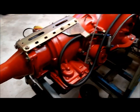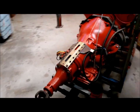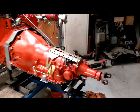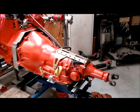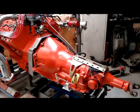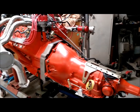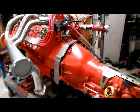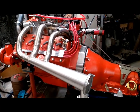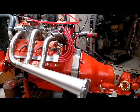I'm hoping our next video will show the whole unit installed into the chassis. One thing to consider when working with these engines — and a lot of other engines of course, but this one in particular — I've estimated that the weight of the engine, the adapter, and the oil in the transmission and engine is somewhere around about 1,350 pounds to lift. It's a big weight, and I've had to make some changes in my workshop to safely cope and manage a load of this size.